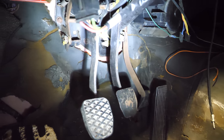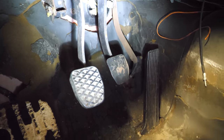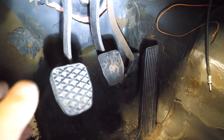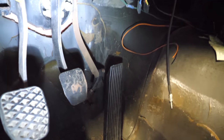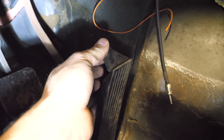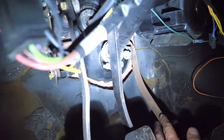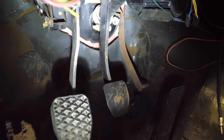I wanted to look at the pedal assembly because something caught my eye — and now I really wish I hadn't. The clutch pedal is like four inches higher than the brake pedal. I don't know if it's supposed to be that way. But the gas pedal is where things really fall apart, because literally the gas pedal is in two pieces. This is supposed to attach to the top and pivot, but it's broken. And there's a lot of slop in the accelerator pedal linkage. Shouldn't have looked.